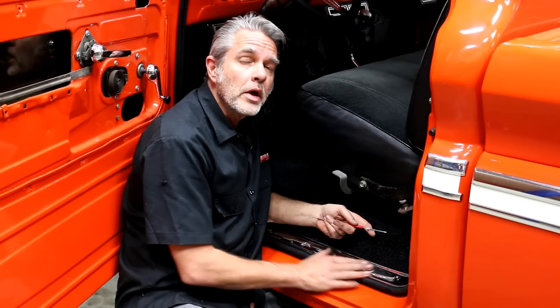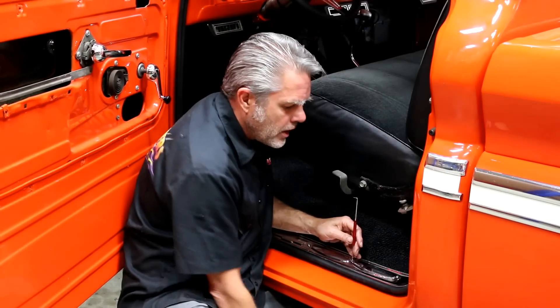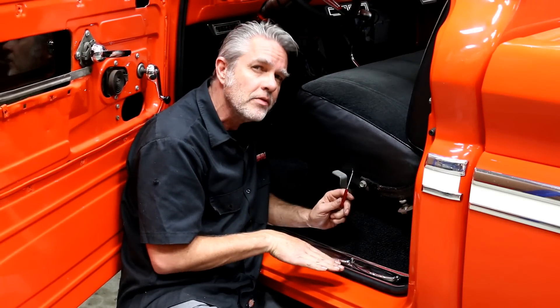Now I'm going to put my sill plate on. You want to remember to put this on after you put in your seat because we don't want to get our nice new chrome all scratched up. I'll get a spiky tool, find my holes, then go ahead and put the screw in — just four or five turns. I'll make sure I get them all in, and when I tighten them up I'll bring it all down nice and even, like I was tightening the head of an engine. Don't forget to check us out on YouTube, Twitter, Instagram, and whatever else they've got these days because we're on that too.